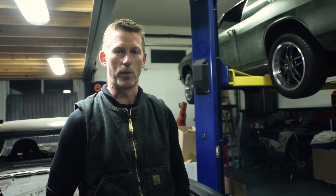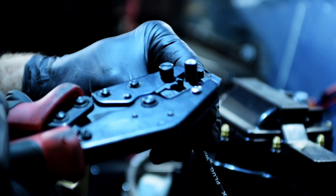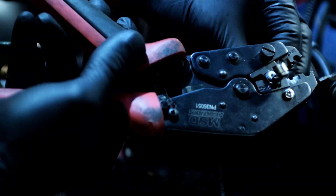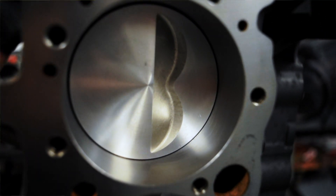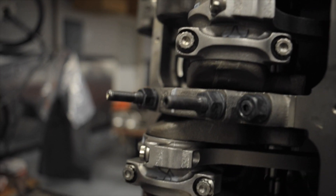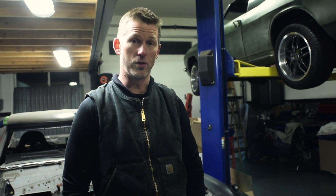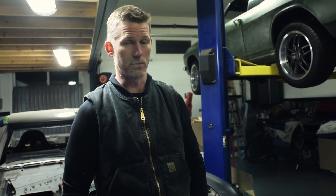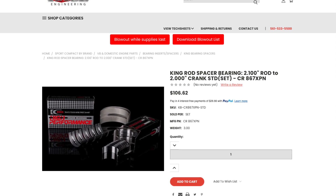People have made a lot of comments on the channel asking, 'How did you make the 283 crank fit a 400 Chevy?' Well, it's because we happened to come across this block that was the perfect opportunity for us to do this crazy idea. And it's worked out really well. We also love building stuff without breaking the bank — pistons off the shelf, rods that already exist, instead of getting something custom made that costs four or five times as much. So we used pistons designed for a small block 400, connecting rods from an LS motor — 6.1-inch long SCAT I-beam rods with ARP bolts. The LS engine also has a large journal rod journal, while the 283 is small journal — about a two-inch pin instead of 2.1. We found some bearings that King Performance makes in order to use a large journal rod on a small journal crank.